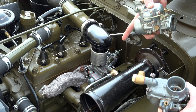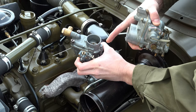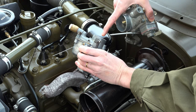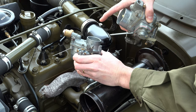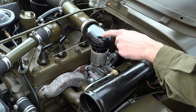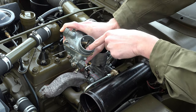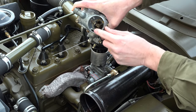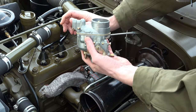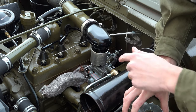There's also a breather for the fuel bowl and another breather — completely open to the elements. Whereas on the 32 PBIC they took all this into account: the breather for the float chamber and the bi-starter air intake are all within the filtered air path through the air horn. So the 32 PBIC is dust-proof, whereas the 32 AIC is not — because it's a civilian carburetor originally used in the 1930s, not designed specifically for military jeep use.